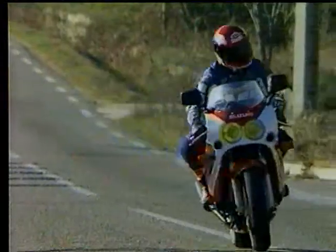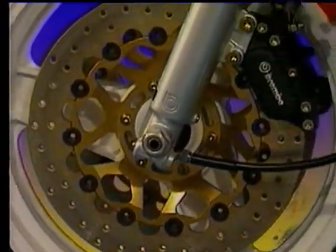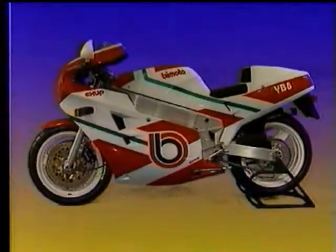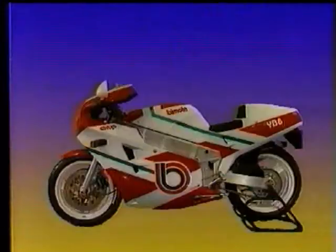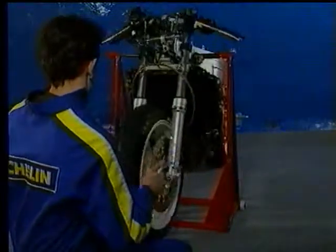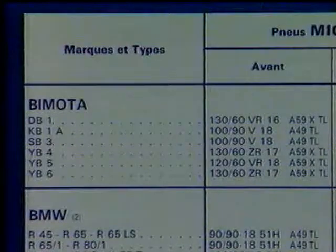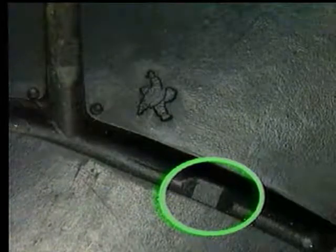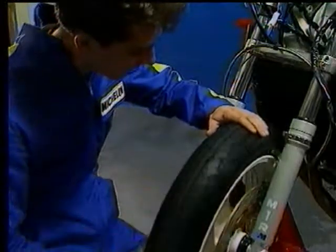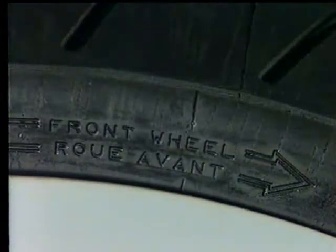A motorcyclist dissatisfied with their motorcycle's behavior in certain situations does not always know how to analyze the problems behind their dissatisfaction. It is therefore necessary to carry out a rapid vehicle check-up, progressing systematically from the front of the motorcycle to the rear wheel. For demonstration purposes, we will strip down a Bimota. Starting with the front wheel: place the front of the motorcycle on a stand. Consult the Michelin chart to confirm that the tire in place is suitable for the rim and type of motorcycle. Check the tire condition by first looking at the wear indicators, and also examining whether the wear is uniform across the full profile. Certain abnormal wear patterns on the front tire can promote shimmy. Don't forget to ensure that the tire's direction of rotation has been respected during fitting.